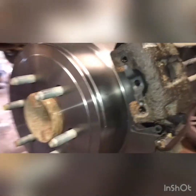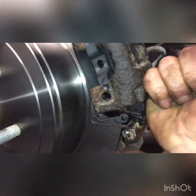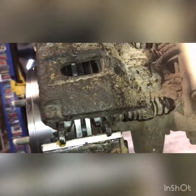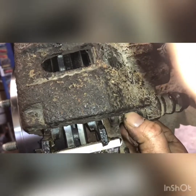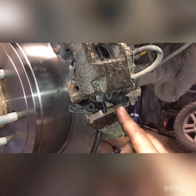There's a groove at the top pad, so you gotta fit the top pad into the ear first, then you can tap the bottom in and that spring will lock in. It might not go on if the sliders are hitting the ear — you gotta push them all the way back. Then put a little extra grease on these ears where they contact the sliding hardware.